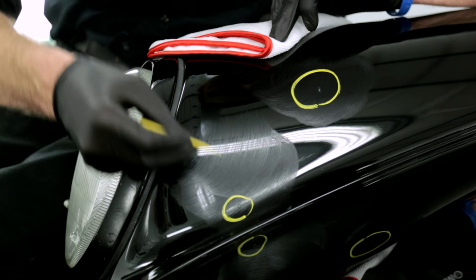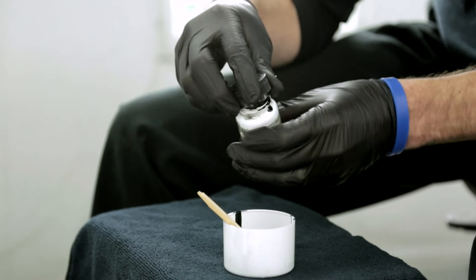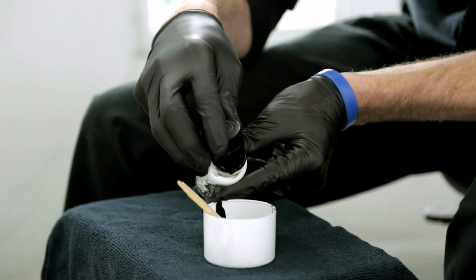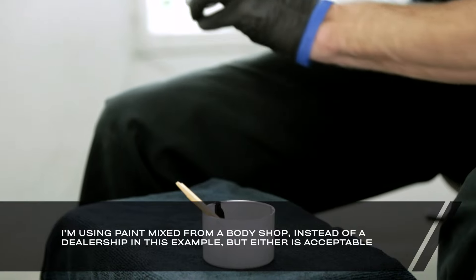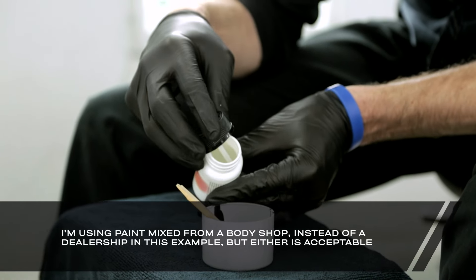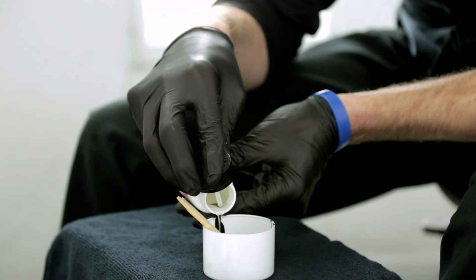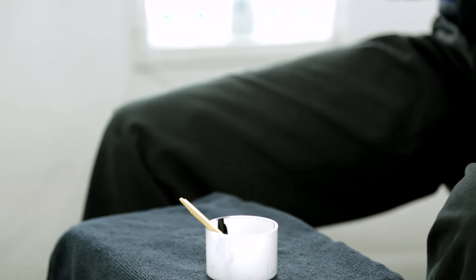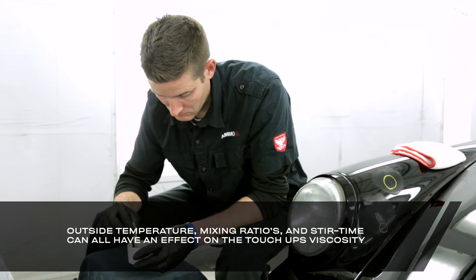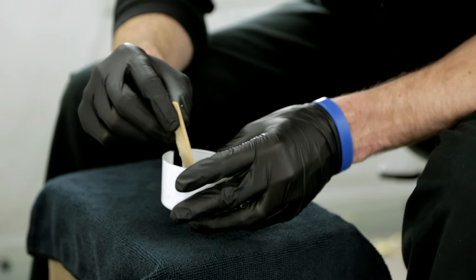Now that the chip is clean and ready to accept the touch-up, we need to mix the paint and clear coat prior to the application. Add an even amount of color and clear coat, then mix in a small cup until it becomes slightly thicker or more viscous than water, but less viscous than syrup. This can be very tricky because there's usually an optimal 10 to 20 minute window of time before the paint becomes too clumpy. Traditionally, color coat was added, dried, then clear coat was added on top afterwards. But from a practical standpoint, this is not as effective if your goal is to have it look good as well. I prefer to mix the color coat and clear coat together prior to adding it to the chip because it's a healthy balance between protection, looks, and ease of application.